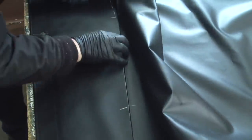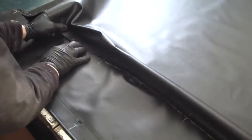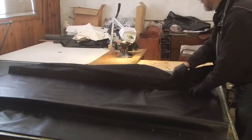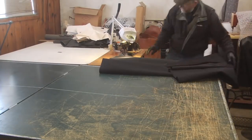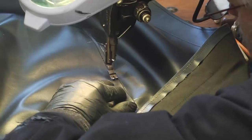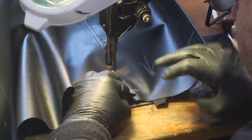This is a better picture of where I have to bend the top deck around the curve of the lower quarter panels. These are really the most difficult seams in the whole top to get just right, because this is where the wrinkles will show or you'll get it right to where it's smooth. Sewing these two seams is a bit of a challenge because it's a fairly sizable piece of material, so I'm using my hand and also my forearm to maneuver this whole piece as I come through, trying to keep it up to my chalk marks.